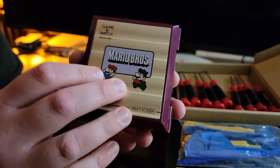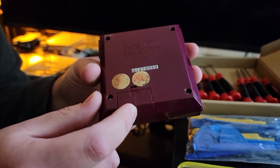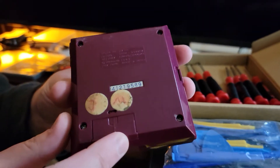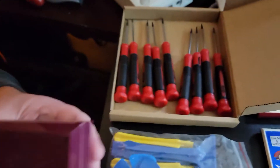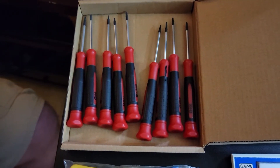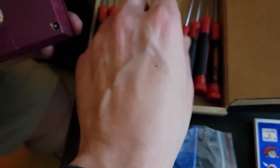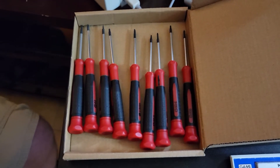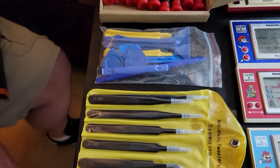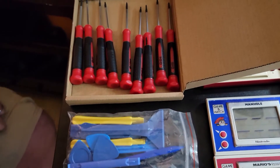So this is a common tip: when you're looking at a multi-screen unit like this, you want to make sure first of all it has the battery cover. This one actually clips in. You would use a mini screwdriver like this. A jeweler's screwdriver kit is something you definitely want to have because these are very small screws. Similar to maybe if you ever did eyeglasses — just different sizes of bits. So those are some of the tools you'll need. None of them are too complicated and pretty cheap, and if you're going to do any kind of repairs, not just for Game & Watch but other systems, this stuff is good to have.